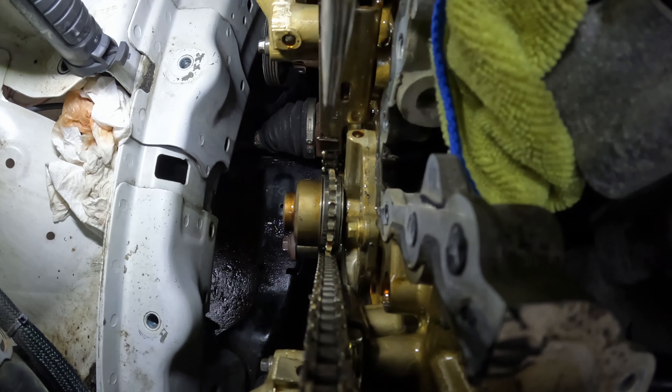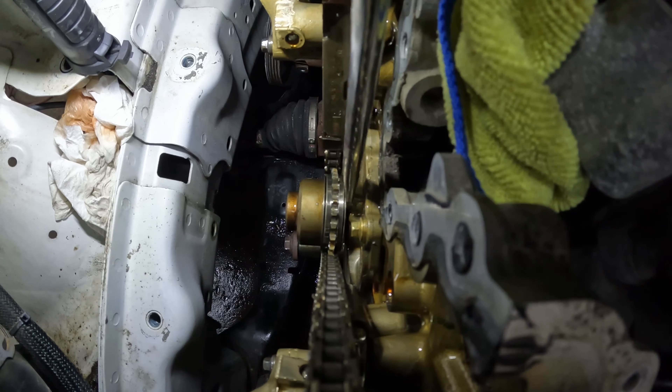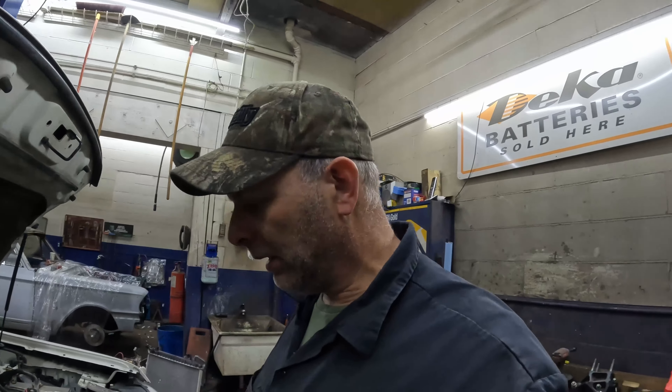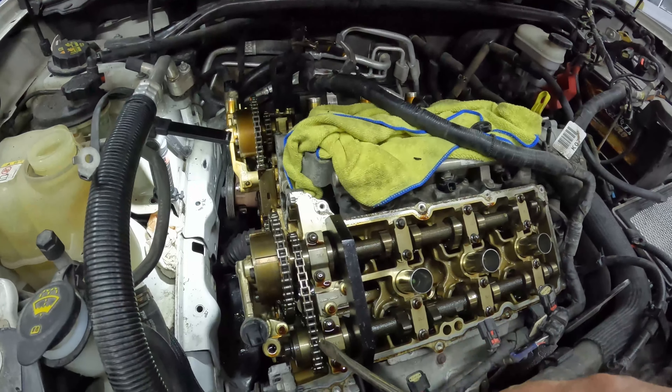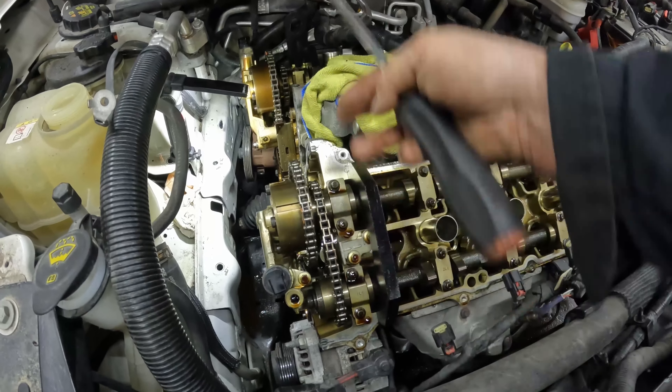Definitely, if it's that bad there's probably metal in it somewhere. So we're just going to end up replacing the primary chain here just because of the mileage on the vehicle — 178,000 miles. We already have the timing chain off, so let's just go ahead and replace it. We're going to replace the guides and the tensioners; the tensioners wear out after a while too. Secondary chains — not much to go wrong with there, they're just a small chain. We'll check the guides and make sure those are all good.